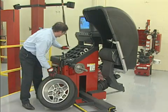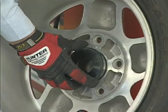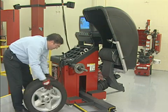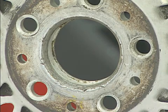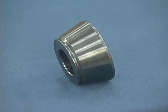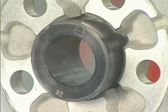With this in mind, it's easy to understand why standard cone mounting has been reasonably successful over the years. But where the standard cone really falls short is its inability to fit in the bore where it belongs. Standard cones actually fit against the edge of the bore, which can sometimes be a questionable surface. And because of the depth of cone adapters, they will often bottom out on certain wheels before making contact with the bore.